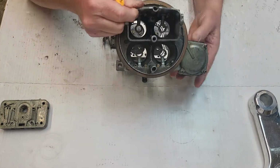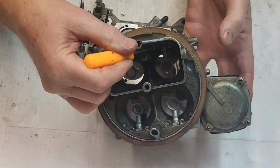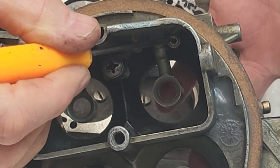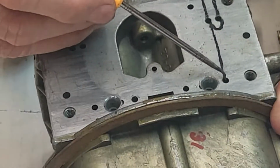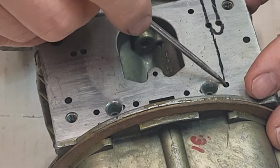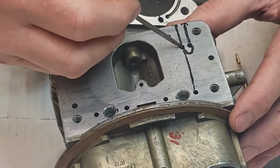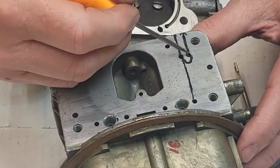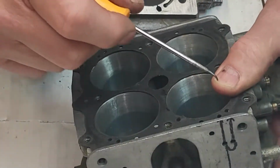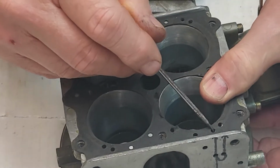All right. At the top of our carburetor inside, can they see that, Mr. Cameraman? Yep. All right, the outboard air bleed is the idle circuit. It comes in right through here, guys. Imagine that's the same circuit; it just comes through the main body. Then this is the transfer slot. All up and down here is considered the transfer slot. And then when it jumps across here with the metering block, this comes out as the idle air adjustable mixture. This is the idle air adjustable mixture. This feeds the transfer slot. It is the transfer slot hole.